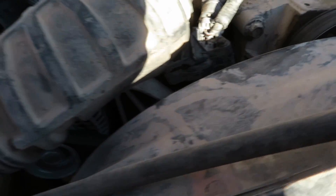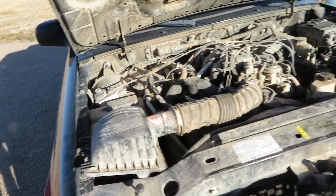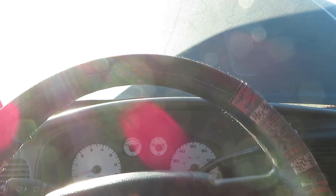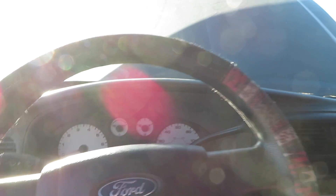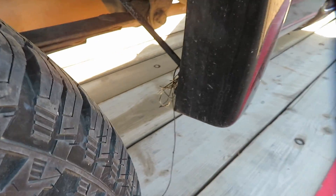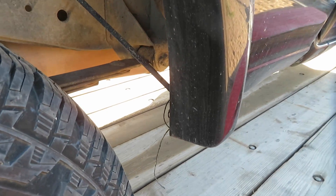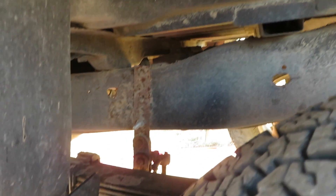There's some stuff smoking too. I wonder if these are timing belt or timing chain — they have to be a chain. I'm going to spray some starting fluid — actually brake cleaner — in there and see if we get a better result. Doesn't sound like it has any compression. Could be from that burnout — he was definitely doing a burnout. Look at this. He must have been at a truck show. You can see all the mud on the frame, and look at that exhaust hanger.